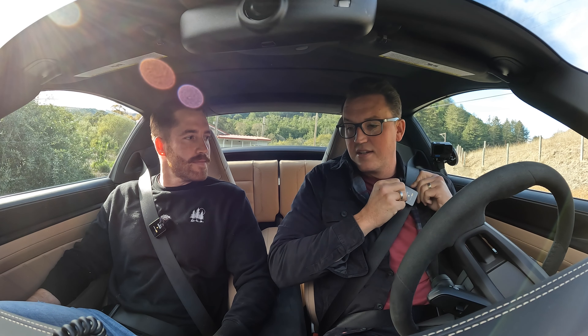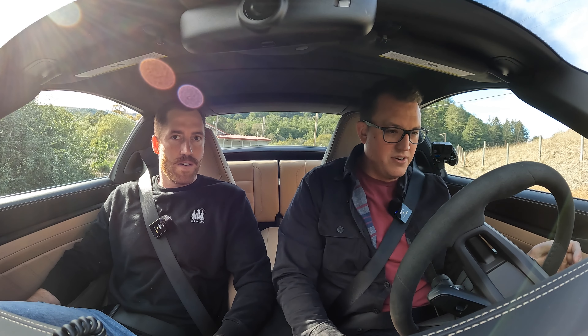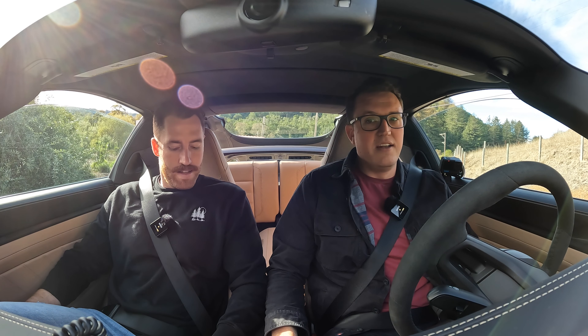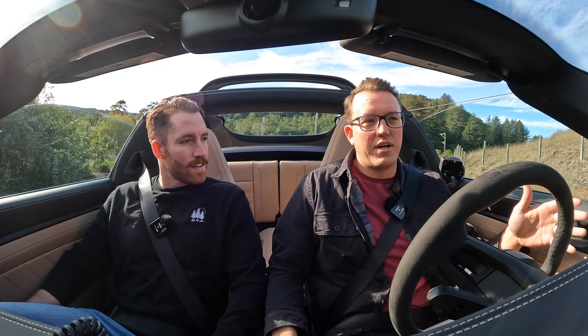Just to quickly touch on the break-in — everyone's favorite subject. I know it's super controversial; there are a lot of people that say you don't need to do it. But when you buy this car — which this spec came out at $185,000 — you feel very strongly that you need to follow the Porsche engineers' recommendations. I plan to keep this car for a long time, and regardless of all the scientific arguments for or against breaking in, I did nearly 2,000 miles under 4,000 RPM. I might have gone to 5,000 once or twice, and now I feel good about driving the car hard.